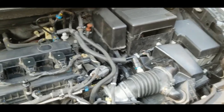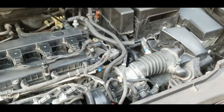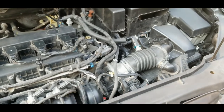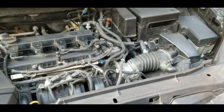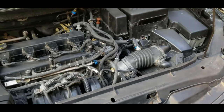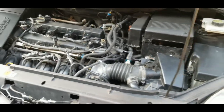And if you develop an air pocket issue, my friend told me that I can just find a slope, like a road going downwards at the front, and run the engine there for 10 to 20 minutes, and he said that it should get rid of the air pocket. Add as much coolant as possible. Okay, let's fire it up.